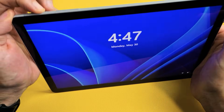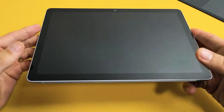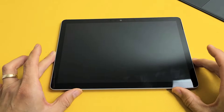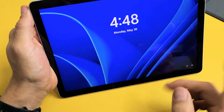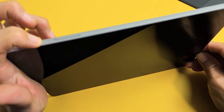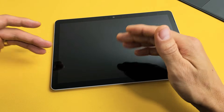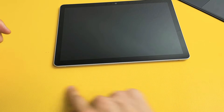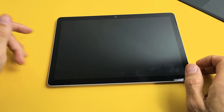If you still have a black screen, the last thing I want you to do is grab your Surface Go 3 — just like this, nice and naked — and go to your freezer. Put it in your freezer and leave it there for 15 or 20 minutes. Let it get nice and cold. After 15 or 20 minutes, take your cold Surface Go 3 out and tap on the power button to see if your screen is on. If it's still black, press and hold that power button while the PC is nice and cold and do not let go until you see a Windows logo appear. If you tried all of these steps and still have a black screen, start from the very beginning of the video and try all steps again — try it at least 7 times. If all of you tried all of these steps at least 7 times, at least 75% of you will have a working screen. Good luck, guys.